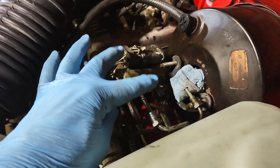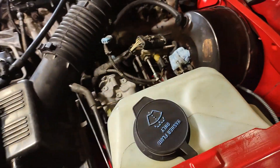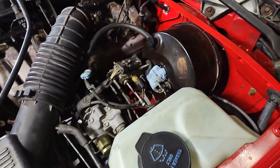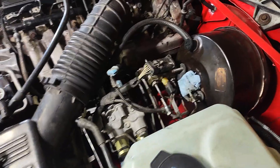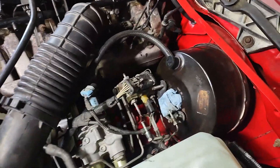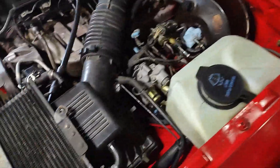Still got to get a brake cylinder reservoir for brake fluid. This Jeep has rear disc brakes, so I need the single cap. That means this is going to have the proportioning valve and everything in this Jeep for rear disc brakes, so I have to have the proper reservoir.